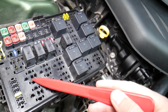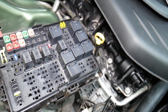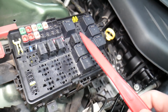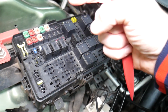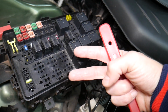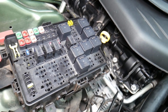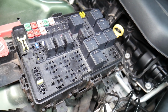And for some certain fuses, it's important to disconnect the car battery when removing them, otherwise you can burn the electronics. For instance, when working on airbag fuses or anything like that, you need to wait at least 1 hour after disconnecting the car battery, and if you're not qualified and certified to work on the airbag system, I would never recommend doing that. But when disconnecting the car battery, a common mistake people make is not knowing which battery terminal to reconnect first. If you do it the wrong way, you can burn electronics modules. How do we know about that? We burned a traction control module on a BMW before that cost us $2,000. So we'll put a link in the description of the video below on which battery terminal to disconnect first. Check it out for your convenience.